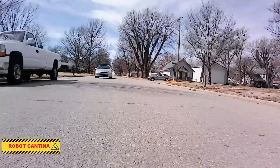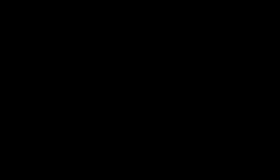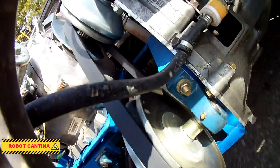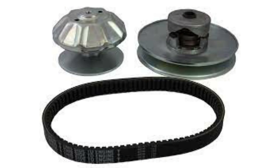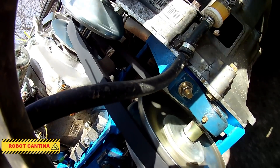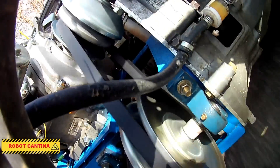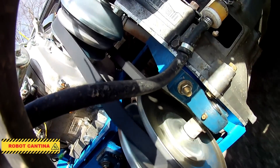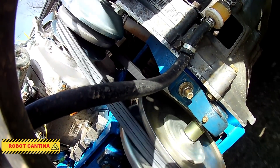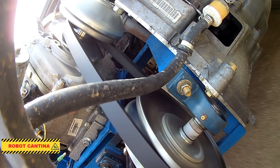The next logical step is to install the supercharger — that's what we all want to see. Unfortunately, we're still fabricating parts and waiting for FedEx to deliver stuff they lost. There is something we can do in the meantime that I previously said no to, and that is to modify the torque converter. This car is equipped with both a 5-speed transmission and a go-kart CVT-type torque converter. The CVT can automatically change the transmission ratio from a low range of 2.43:1 — effectively first gear — and as the car accelerates, the ratio automatically changes until it reaches 1:1. By using the torque converter, we amplify the torque the little engine makes, which helps accelerate the car. For top speed, though, we need more power, and we're counting on the supercharger for that.